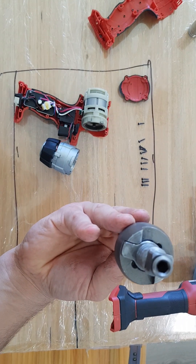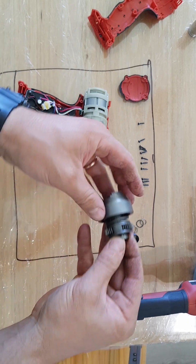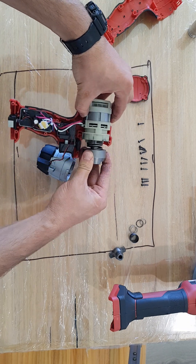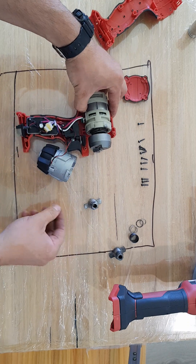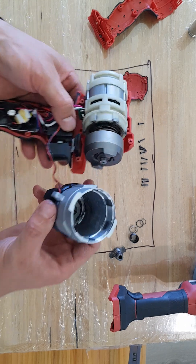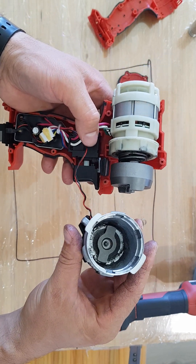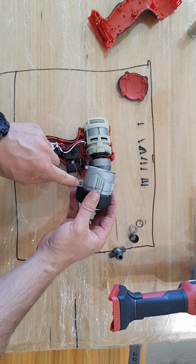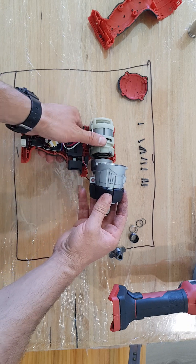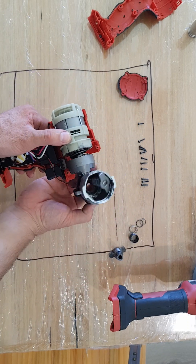Let me put it back together now and we'll give it a drive test as well. I'll do it in reverse — just put that one in there, rub that one in, put these two back together. Just watch out for this cable — these two cables. When I put mine apart it was set wrong from factory; the cable was on top of this metal. You want it underneath, otherwise it's gonna get squashed and damaged, and you might lose the working lights in front.